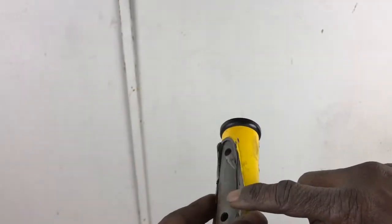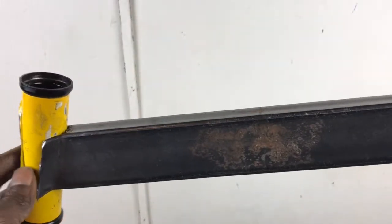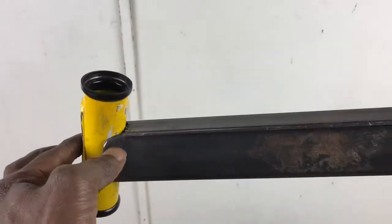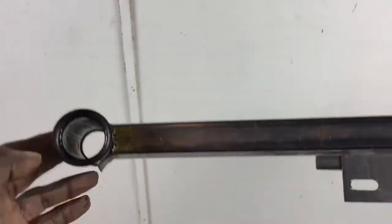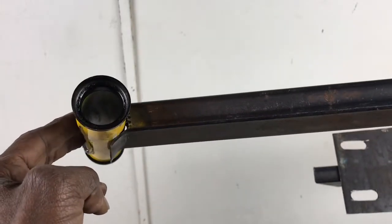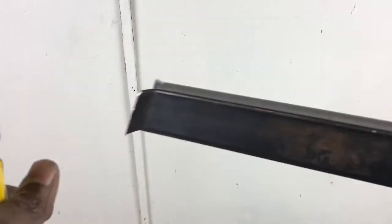Now that I have my headset cut out, I'll remove this stuff a bit later. I've got to clean this off down to bare metal so that I can weld it on. It will fit up like that. I'm going to tack it in one spot, probably right here, and then that will allow me to pivot and move it to make sure everything is totally aligned. You'd be surprised how great the human eye is to get things straight. I'll get this totally spot on, put the forks back on, and then get the engine mounted up to the plate to see how things fit together.